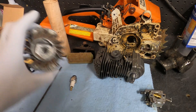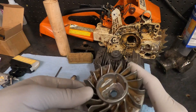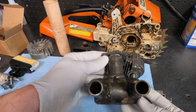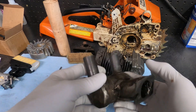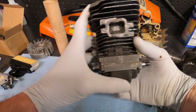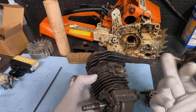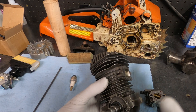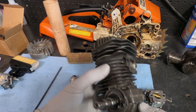On the flywheel, we'll get in here and take a little more off the key so we can advance timing further. Here is the exhaust we were running — I'll likely put it back together with the same exhaust, but I do want to move to an iron horse style exhaust where we can do some testing. I want to try to predict the speed of sound, the time it takes to leave the piston, bounce off a hard wall, reverberate back within a quarter wavelength theory, and try to get some extra scavenging in the cylinder that way. That won't be on this set of modifications, but it's one I want to do moving forward.